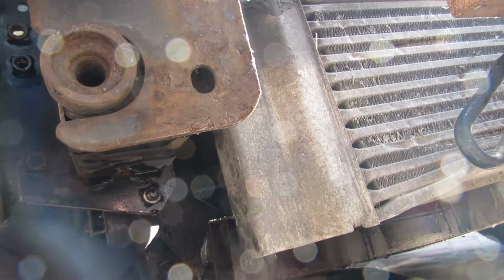But the... what's that stuff called? The gasket that's like composite we've used, and we've used a little bit of this on each side, just to make sure that it doesn't actually leak. So, we'll do these up, these are set at 20, aren't they? Yep. So 20 newton meters for the big ones, 14 newton meters for the small ones.